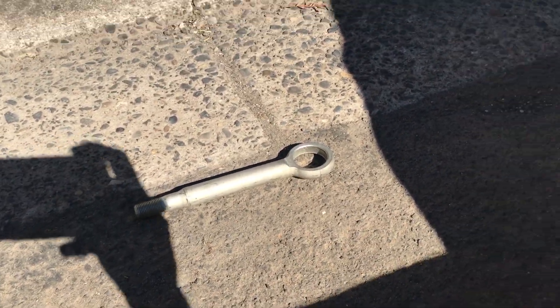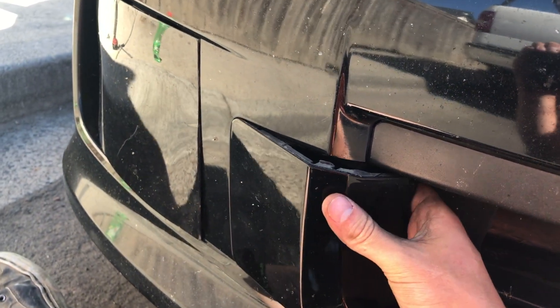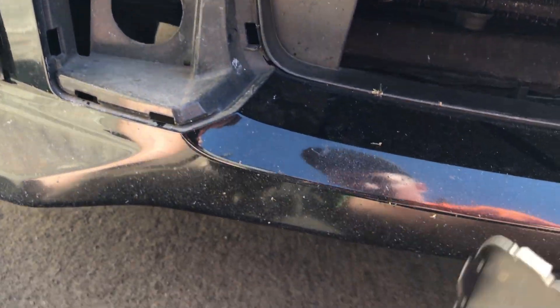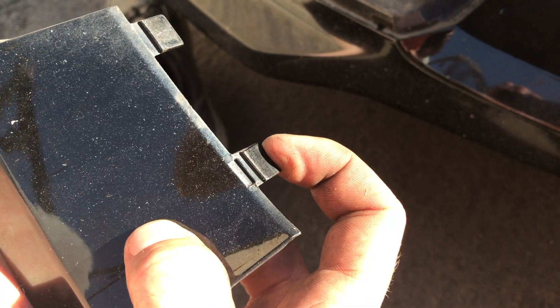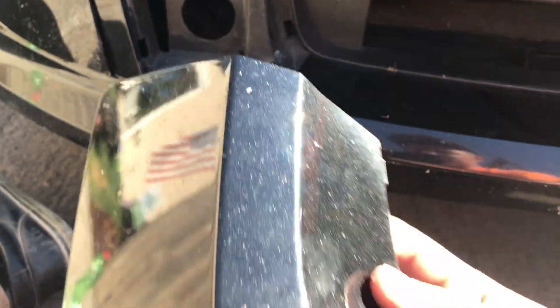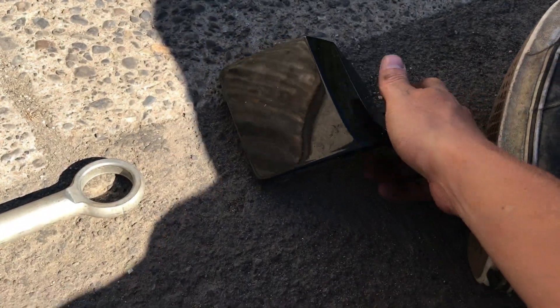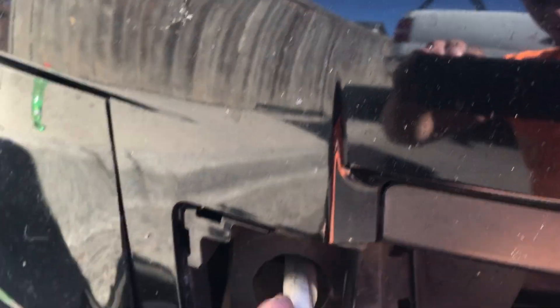Since the car is not going to be running and I'm going to have to tow it, I'm going to install the tow hook into this little section right here. You can access it from underneath or from this way, but there are two tabs you can push on and it'll start to pop out. Then you just pull it right out — that's where your tow hook goes. Just push those tabs in and get the cover off, then be careful not to set it face-down because it will scratch. Grab the tow hook and it just threads right in.